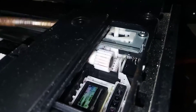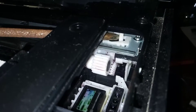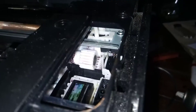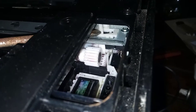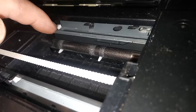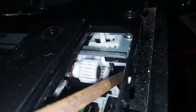Error 73 is all to do with this cleaning assembly down here, and in particular it is to do with this actuating mechanism in here. This actuating mechanism is spring-loaded — the spring drives the actuator up and down, backwards and forwards. It's a dual-action actuator: you've got the top bit which gets pushed on by the movement of the head, so this little bit here goes up and pushes on this bit here. This actuator also has this bit down here — remove it and you can see it separates as well.